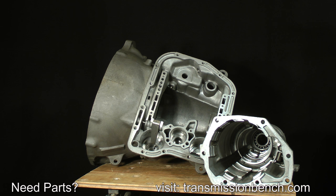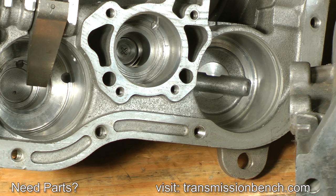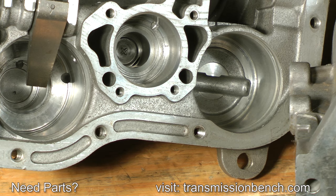Make sure that you blow dry the few steel parts, such as the apply lever in the case and the parking pawl and bearing in the overdrive housing, as soon as possible to minimize rust. Inspect all of the bolt holes for damage. It is very common to find one or more pan bolt holes with stripped threads. I actually had to install three helicoil inserts into this case. Inspect the valve body bolt holes too.